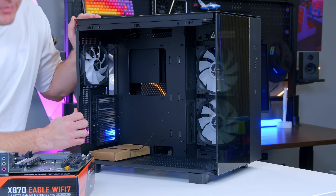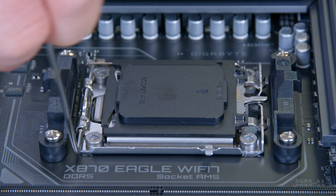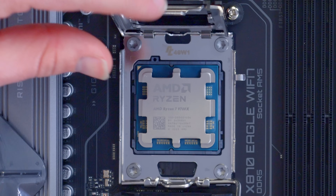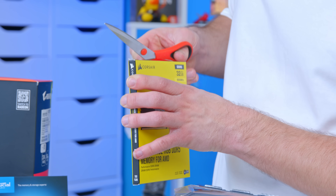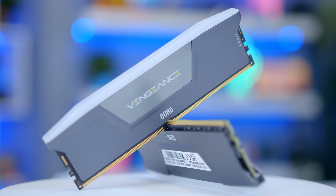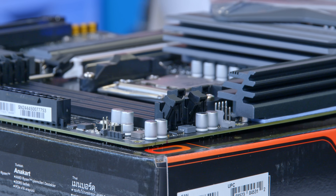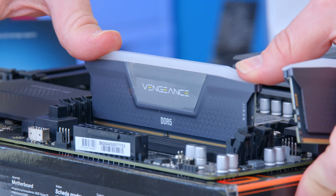Now I've finished nerding out over the PC case, I'm going to start with the motherboard assembly. The CPU installation is really easy — push the arm down and up, pull the socket cover out of place, then drop the CPU in. There's a little golden triangle in the top corner which all matches up nicely, and the socket cover returns down. Next step is the memory: opening up the 32GB kit of Corsair Vengeance. I'm going to pull the clips back on the second and fourth DIMM slots — there are only clips on one side — then slide the RAM in with a bit of pressure.